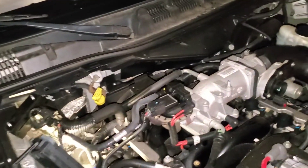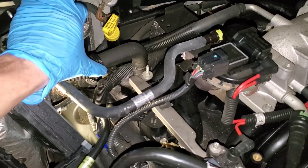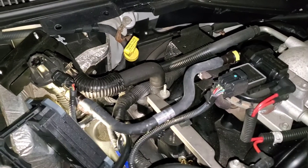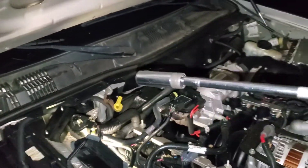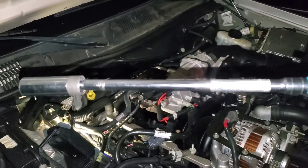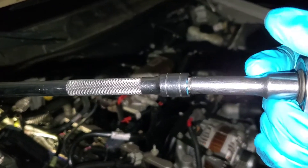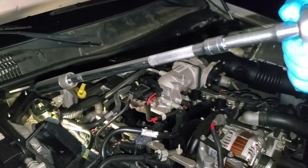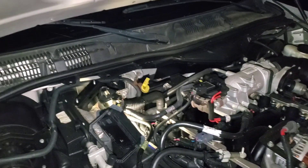Here's the old spark plug — looks pretty worn out. I've now put the final eighth spark plug in the hole. What really helped was pushing that tube out of the way to get clearance. I used a Tekton torque wrench with an 11-inch extension and a swivel socket, plus a 3-inch extension — you probably don't even need the 3-inch. No fancy universal joints or anything. Pretty cool — I'll put this back together and we'll be done finally.